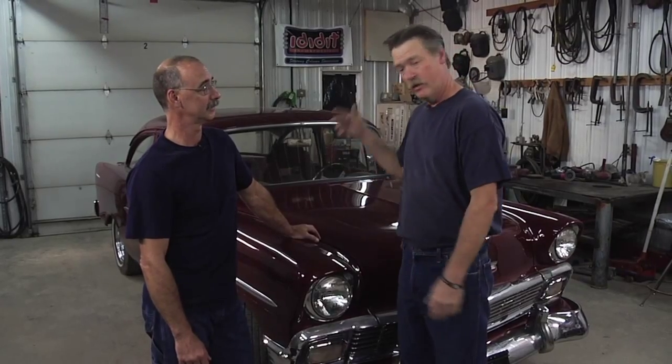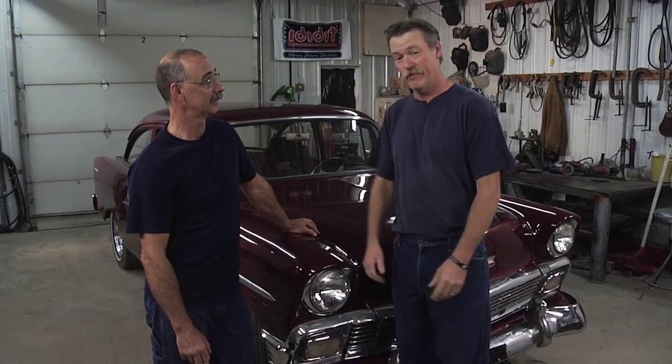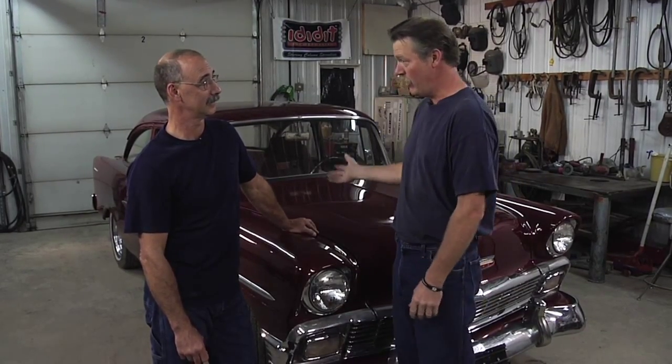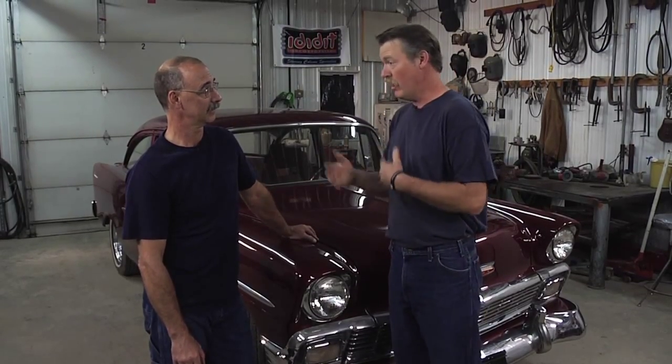It's a 1956 Chevy base model 150. When we got it, it was a rolling chassis — no motor, no transmission. We pulled a motor out of a 1986 Chevy pickup, had it rebuilt, put that in with an automatic transmission, did some metalwork and paintwork to get it looking like this. I had some seats out of an S10 that just didn't sit right, so we made some brackets and put in seats out of an '85 Toyota Supra, which seemed to be working out really well. We also put the steering column in — it's coming along very well.